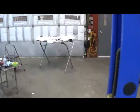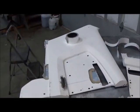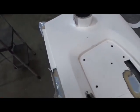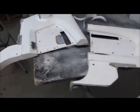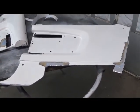And then over here are my panels. These are my back panels. So these were kind of cut and shoved to fit, and parts of it wasn't long enough. I make these little trays, and I'll do fiberglass mat and lay that in there, and by the time that gets done, it's pretty much the shape of that. But I'm going to fill all those with a little mat and resin, raise the landing on that a little bit, that door seal plate.